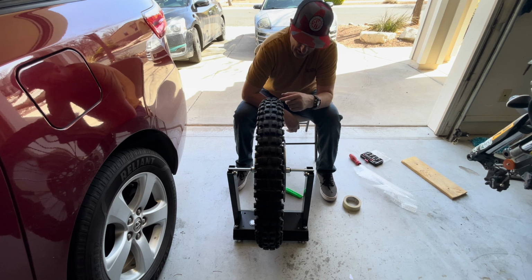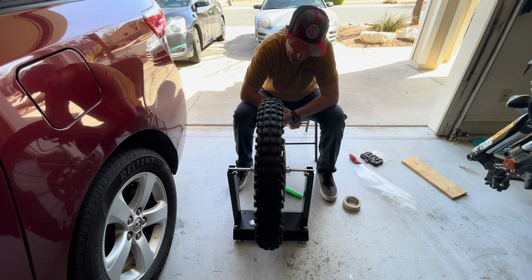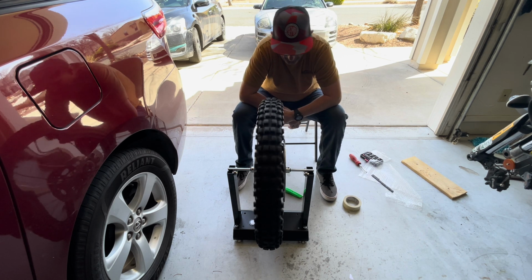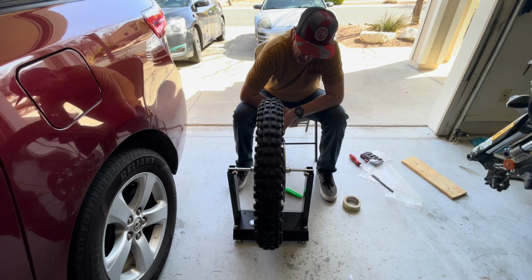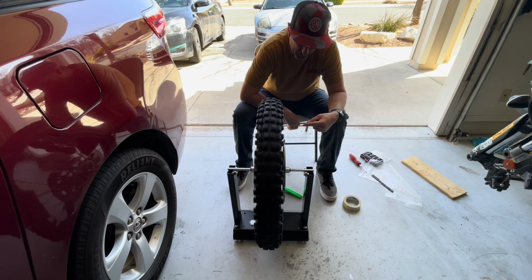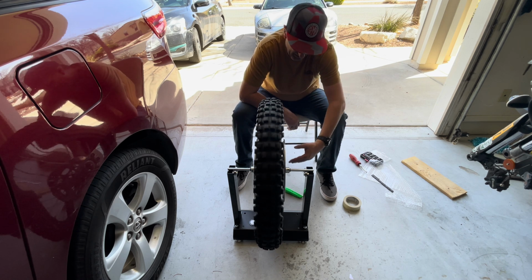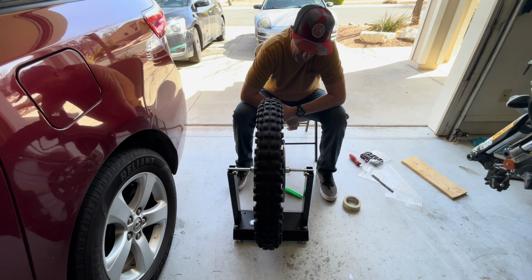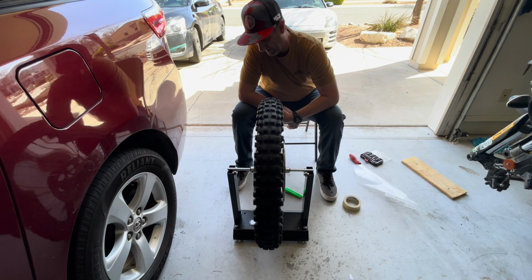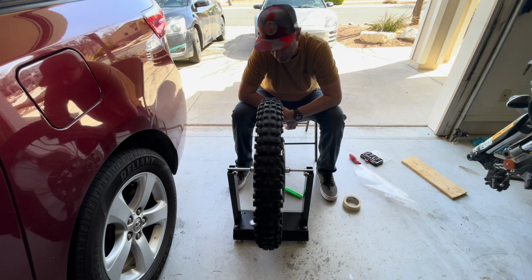So now these weights are stopping in various places, and the wheel's not retracting, which to me means that this wheel is balanced pretty well, because whenever it's spinning and then it just stops, it stops right there. There's no going back. The heavy part is not settling back to the bottom, which means that this tire is pretty well balanced now. So good news. 3 lunches later.